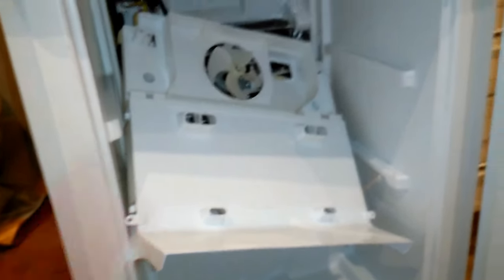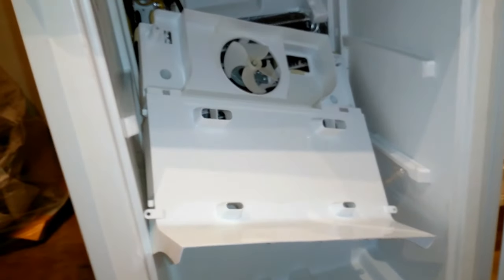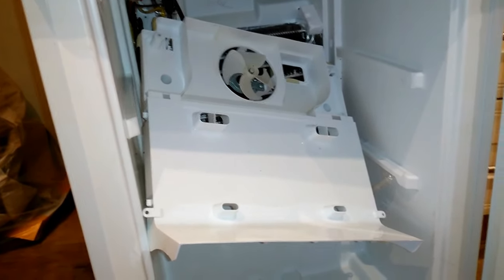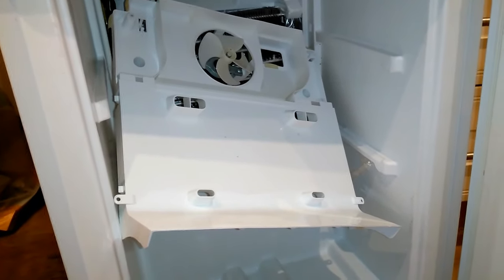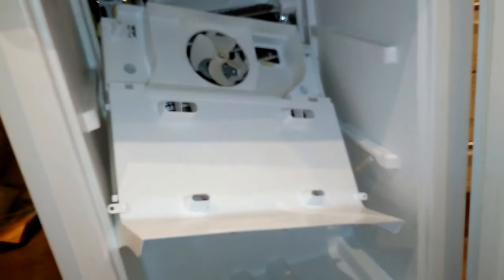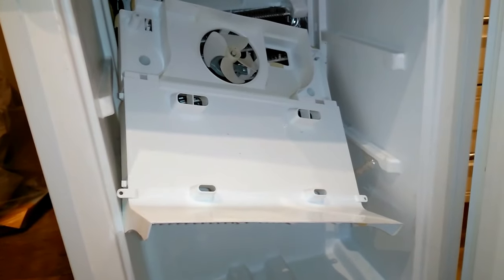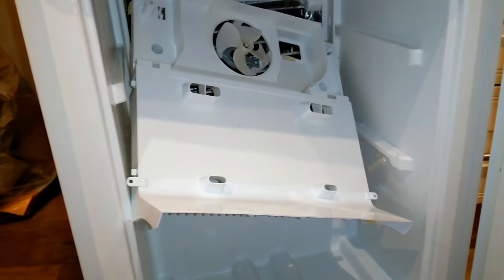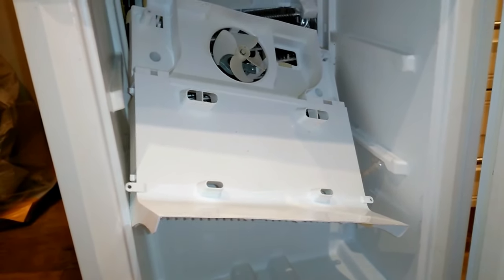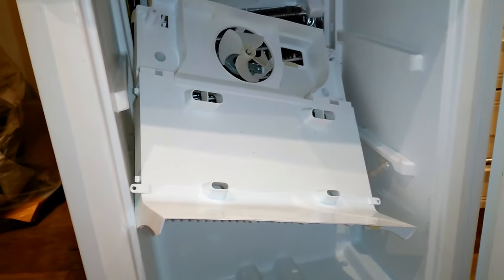In summary, if you have this problem of water coming out of your freezer: first, if possible, check around the back and make sure none of the interior pipes are blocked, because they can block up sometimes. But what you might simply have to do is completely defrost your freezer — you won't need to take it apart like I have. Just switch it off for 24 hours in a warm house and that should melt the interior ice completely and clear any blockages. Then hopefully you can turn your freezer back on and won't have this problem again for some time. Hope that's been of use — thanks for watching.